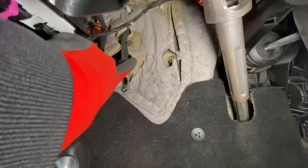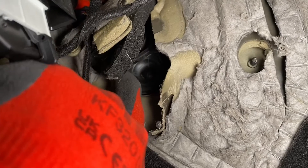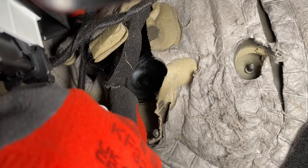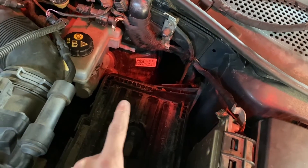On the left side of the vehicle we can see the wiring I've talked about, and below it there's an empty spot we can use to wire through the firewall. I'm going to puncture it with something and check if we can see it on the other side. I'll start with the smallest screwdriver — it's through this plastic grommet, and if I squeeze my hand over here I can just barely feel it, but I can't show you because there's no room for the camera. Now I'm going to try to push the wiring through this hole.